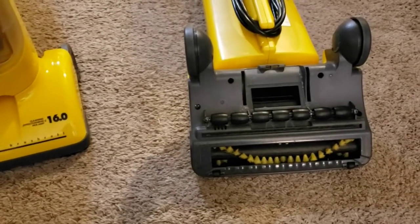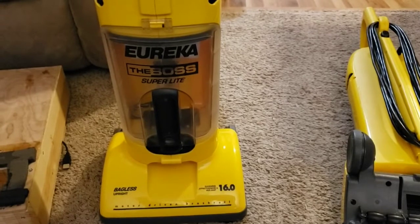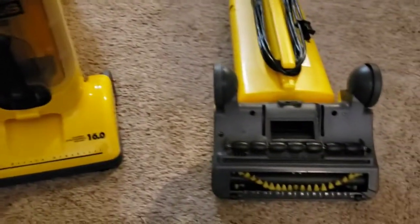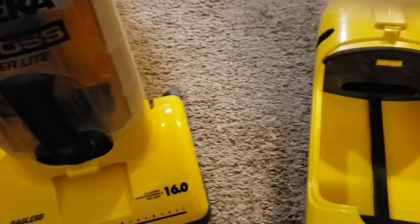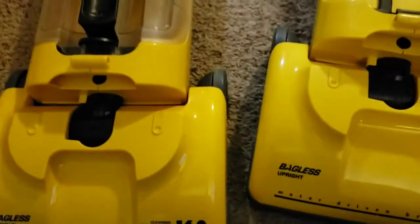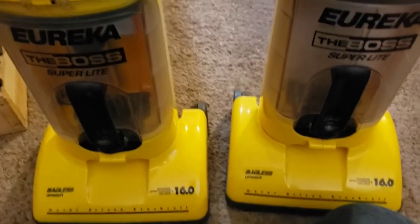Now it's kind of like I didn't even really need to bother with this unit in the first place. But just to save some time, I'm only going to measure the voltage and wattage off of one of these machines, and for fun we will do the airflow test on both of them. I'll just have to steal the door off of this one to put it on the screen one temporarily. The screen filter ones have a rubber-like gasket on the top, whereas the ones with the dust cup filter don't, so I figured that probably wouldn't work too well since it didn't have a proper seal.